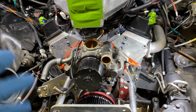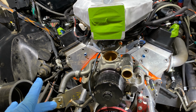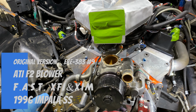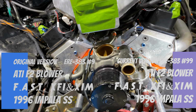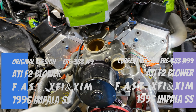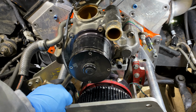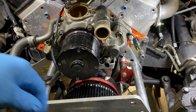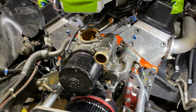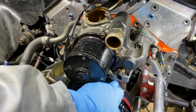This is from Kent Eden from Sweden. He set this all up and did a wonderful job. Very well engineered. Jan Aki Norberg Race Cars built a lot of this, the plate, and this is a Bostic Pro Mod crank girdle. If you have a supercharger, these are awesome. It keeps the crank from pulling and bending.